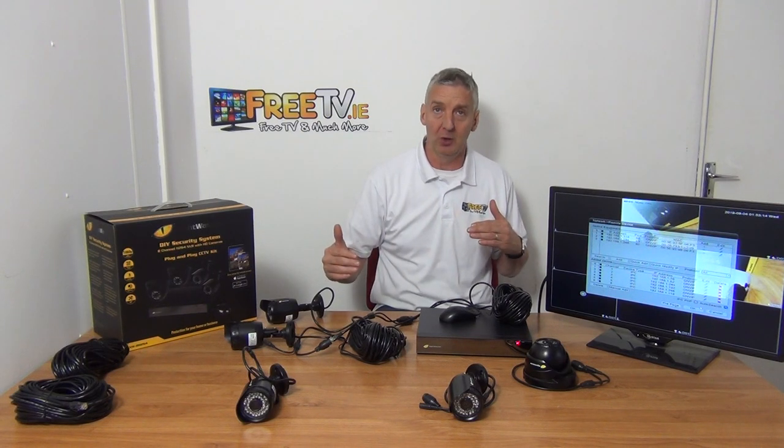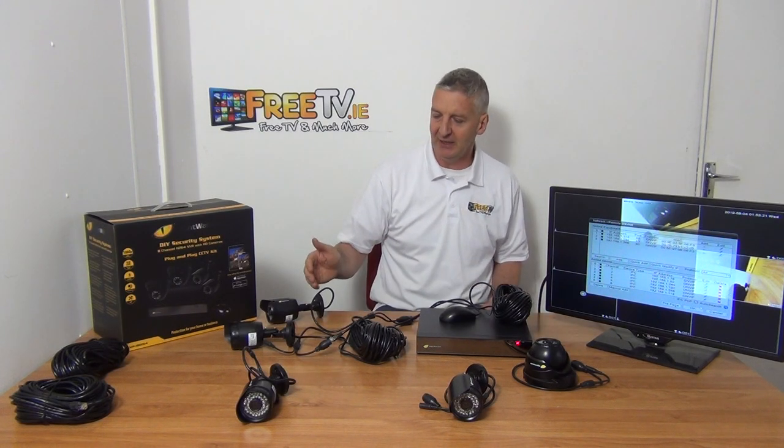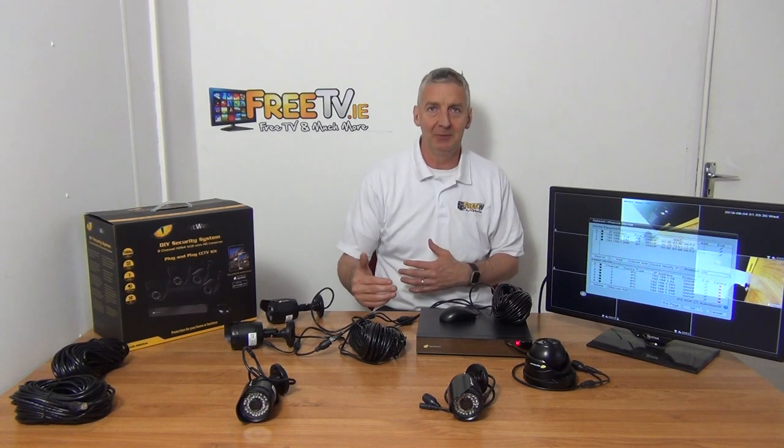Just say AutoSearch wasn't ticked — it is by default — but if it wasn't, you can go in and tick it and it'll actively look for new IP cameras. Now this is a key point: when you get this kit, the one thing you must not do is plug in all four cameras at the same time. How IP cameras work is not the same as a CVI camera with a DVR. The NVR is looking at each camera's IP address and allocating it, then communicating through that IP address afterwards. It needs a little bit of time to do that. So plug in a camera, wait a minute or two, the camera picks up, then plug in the next one.